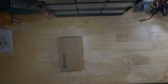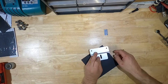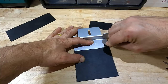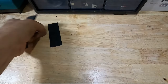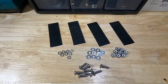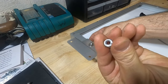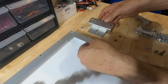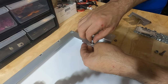Let's get started. I'm using Renogy RV and camper mounts for the solar panel. I picked up some rubber pad to use under the aluminum mounts to help dampen any vibration from the vehicle. The pad will also provide some protection from water leaking in through the roof. I'm using only stainless steel hardware to prevent rusting, along with nylon lock nuts and lock washers to ensure the mounts do not come loose over time.